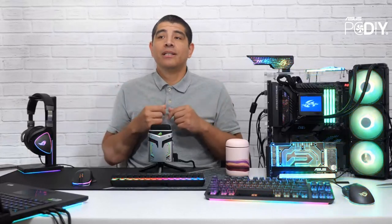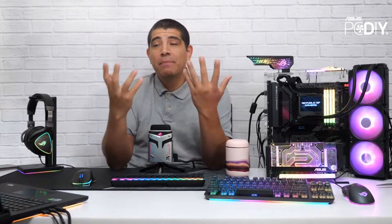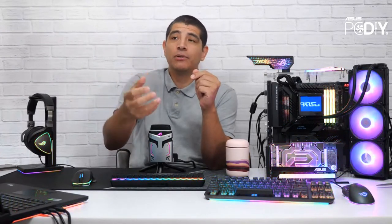You could have a wireless signal that's, let's say, 1.5 gigabits, so 1,500 megabits of speed. That's awesome, really, really fast. But maybe that only happens within the first 10 feet of the router. When you get to the next 25 feet, maybe that drops down to about a gigabit. And then when you get to, you know, 150 feet, maybe it drops down to 500 megabits. So that's the goal of getting a higher performance router that gives you better range, but also higher speeds. It's about trying to make sure that the speed that you get at the furthest point away from your router is ideally at least as fast as the experience that you want to have, and hopefully matches the speed of your ISP, right? Because that way you can always leverage the most that your ISP can give you, even at the farthest point away in your wireless environment, right?